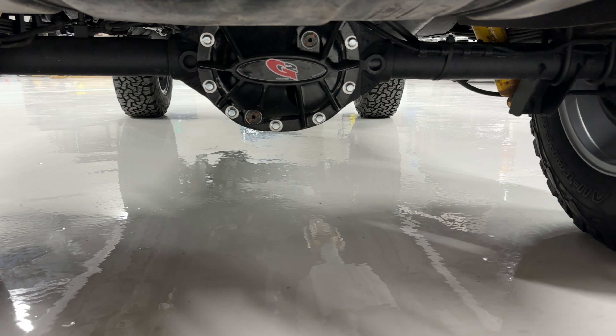When seats come out we refinish the seat brackets — sand all four brackets on each seat completely smooth, prime them, paint them, and put new gray tin hardware on. These bolts are exposed and especially the back ones underneath can get rust when wet, which is very common, so that's why we do gray tin hardware. Bottom of the doors are literally perfect. Carpets are completely steam cleaned every square inch, and we have WeatherTech floor liners and a brand new headliner and visors.